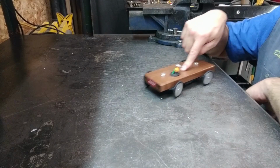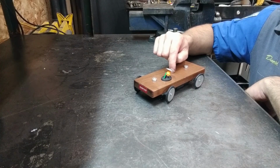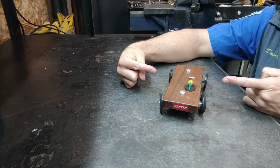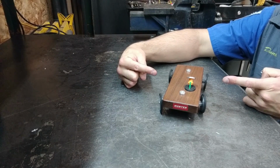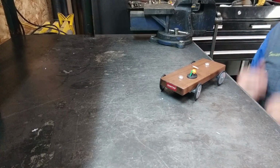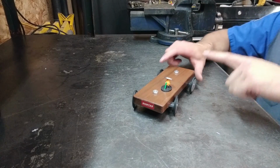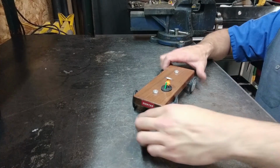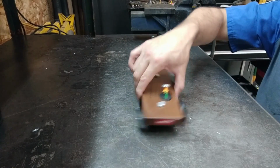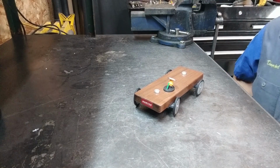As the vehicle is navigating a turn, the lateral accelerometer, also known as the G-force sensor, is determining forces acting from the sides or laterally. It can also be configured to provide longitudinal acceleration and deceleration. So as a vehicle navigates a turn, depending on the speed of that turn, its lateral accelerometer is going to go towards the outside of the turn, and it's using that G-force acting on the vehicle from that direction, combined with the yaw rate sensor, to make the determination or the calculation of whether or not the vehicle is in fact turning.